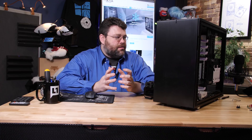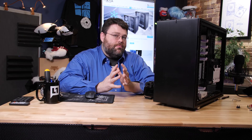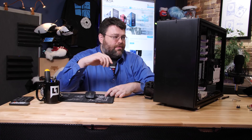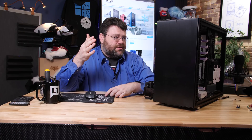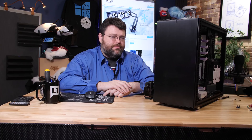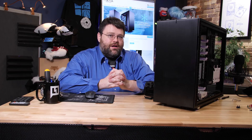I like that this case is a little bigger than most cases that vertically mount the GPU. The Fractal PCI Express breakout slot kit has a lot of cable length, which means you can still use your regular expansion slots without blocking them. Some shorter cable kits will actually prevent you from using any PCI Express slots on your motherboard when using the breakout kit for the vertical GPU. I actually like this Fractal setup a lot better because theoretically I could get even more PCI Express devices in, since the GPU doesn't block any expansion slots whatsoever.